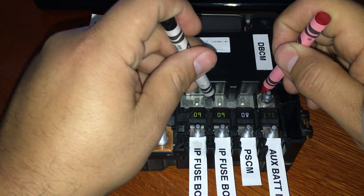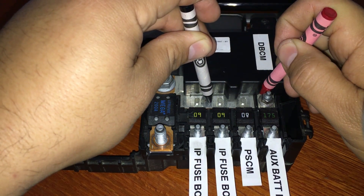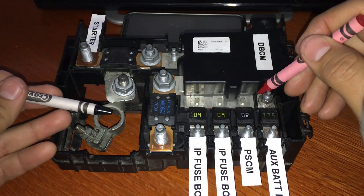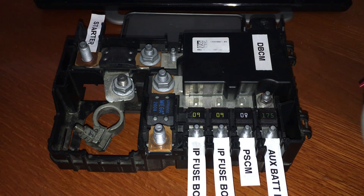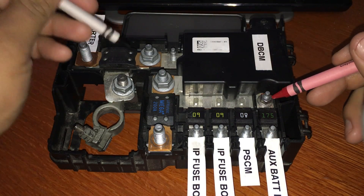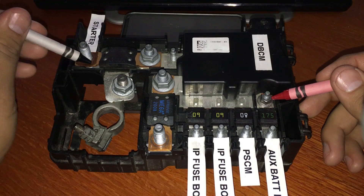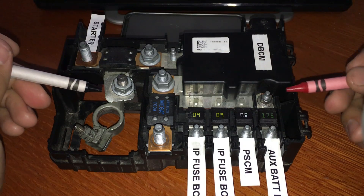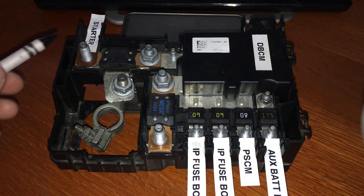Likewise, you could do this check at the auxiliary battery input pad and touch the pad for the accessories — during cranking you should have zero ohms of resistance between those two connections if everything is working properly. Also worth noting: there will be times when both battery connections are tied together — specifically while the engine is running — because the alternator, which is directly connected to the cable attached to the starter motor, needs to charge the auxiliary battery. So both battery connections need to be tied together while the engine is running in order for the auxiliary battery to charge.